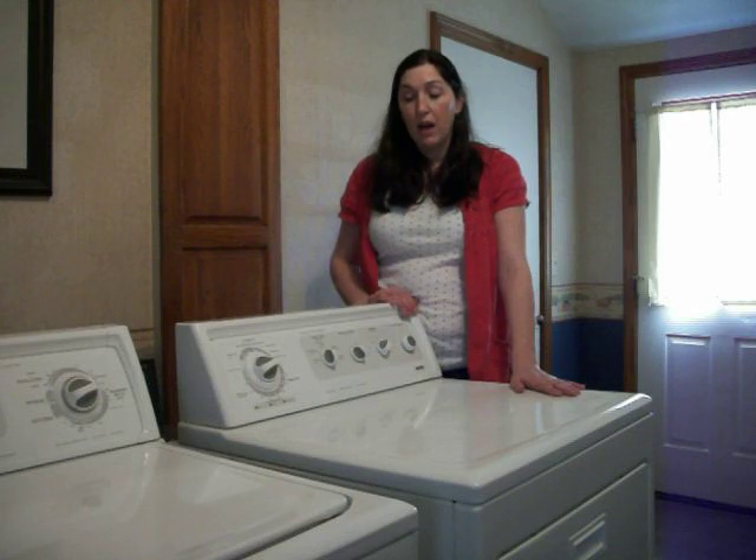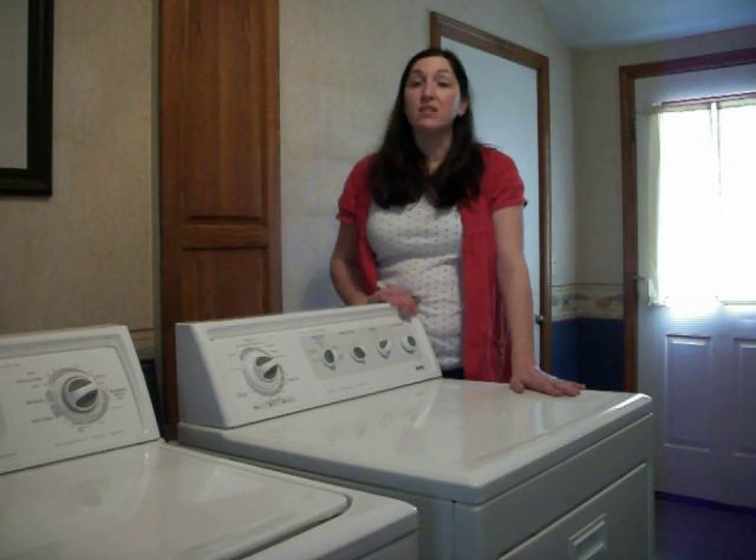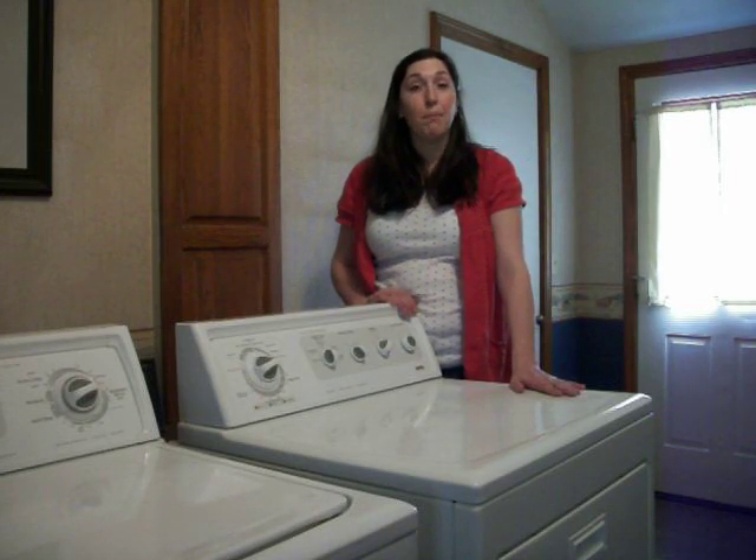So what you need to do is keep it free of lint and it won't blow the fuse. It will run better, giving you shorter drying time, and it will run like new. So if you're having problems with your clothes not getting dry all the way, start with this, because a lot of times it's a blocked air duct.